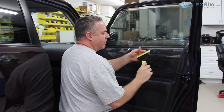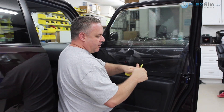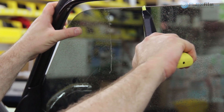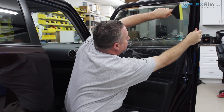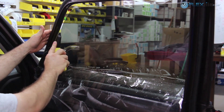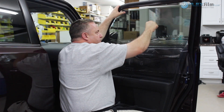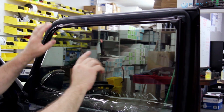This is my current favorite hard tool — the Go Doctor or the yellow turbo squeegee. I like these because they can easily be replaced, the handles are always good, and you can try the red one, the blue one, different hardnesses. Now that we've got the film positioned, I'm going to begin my hard tooling process along the top edge, putting some muscle behind it — not a lot, just making it very firm. Then I'm going to go down a little bit further, working it slow. This is a pressure-sensitive adhesive, which literally means that when you put pressure on it, it begins to do what it's supposed to do — stick. When you can get this stuff to stick, now you're in control. We can roll this up and we don't have to worry about any sliding if we do this step correctly. The next thing I want to do is dry this top edge — there can be a lot of confusion with this top edge if you don't get this water off. This is a secret to making this edge really clean.